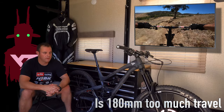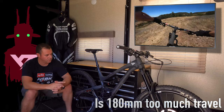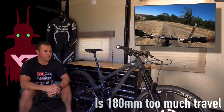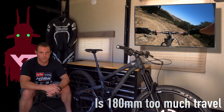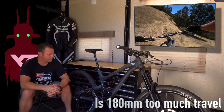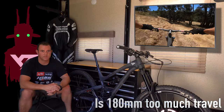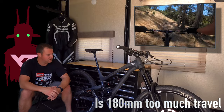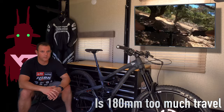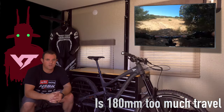It was almost like riding a hardtail — it was just way too firm for me. Recently I've lowered it down to about 95 PSI in the front and 190 in the rear, and that's made a load of difference. I think I'm sitting at about 30 percent sag or just under 30 percent sag front and rear. Even climbing has felt better — the tires track the ground better, less bouncing and tire spinning. The tire just sticks, and I don't feel crazy bobble while climbing up hills.